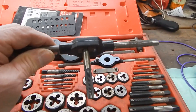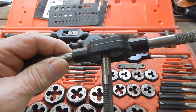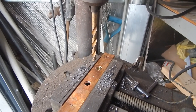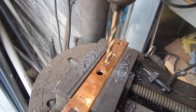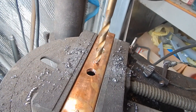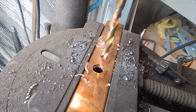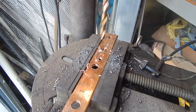You're going to need a 3/8 by 16 tap, which requires a 5/16 drill bit. Here's the drill sequence. Okay, that's how you drill the hole — 5/16. That's where Tony's tap goes.